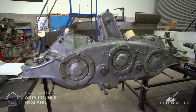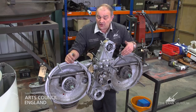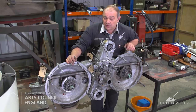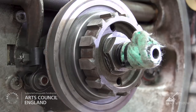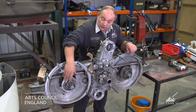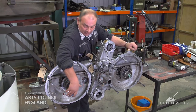This is the cross drive — it's a very important piece of kit. As we've already explained, it's a twin engine power pack, so at some point both of these engines have to come together on a shared gear train to give you a single output shaft that feeds the gearbox. This also incorporates the vehicle clutches for each engine, and there are about five square-cut gear trains that run across this. Once rotated by the engines, it operates the take-off for the gearbox and through the PTO shaft.